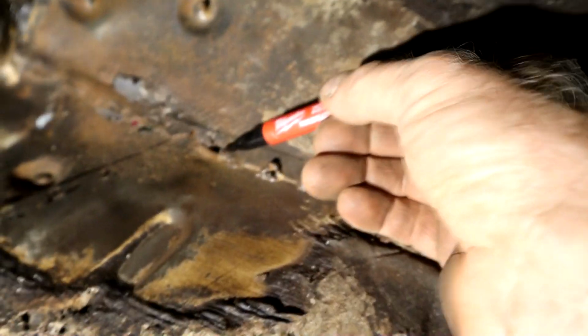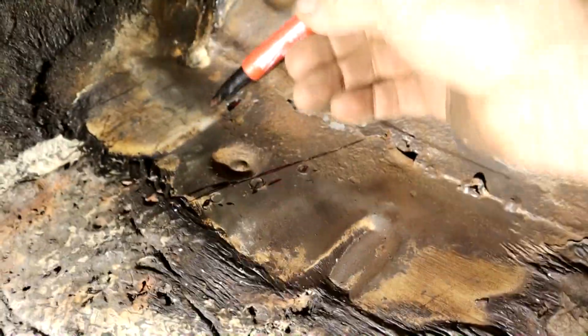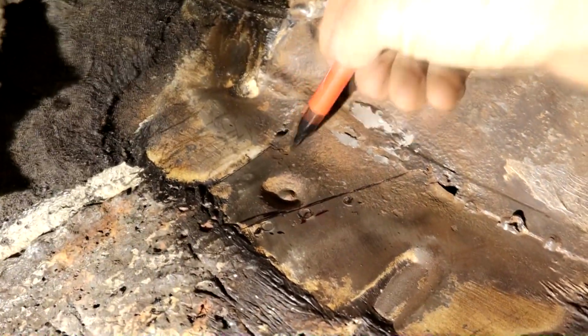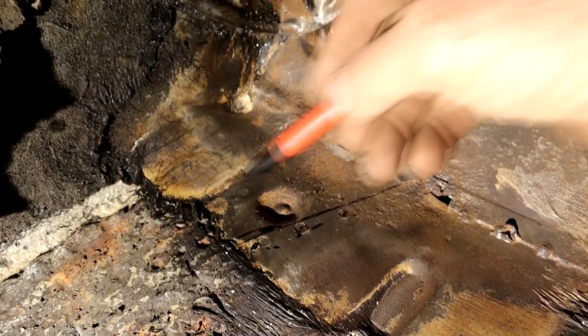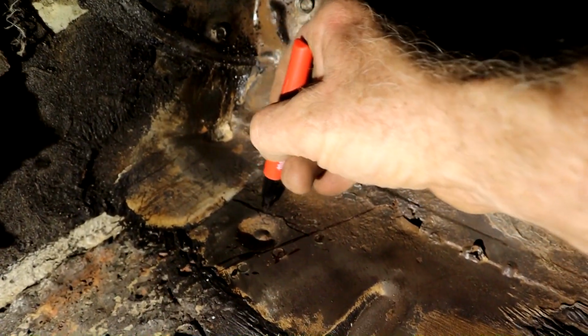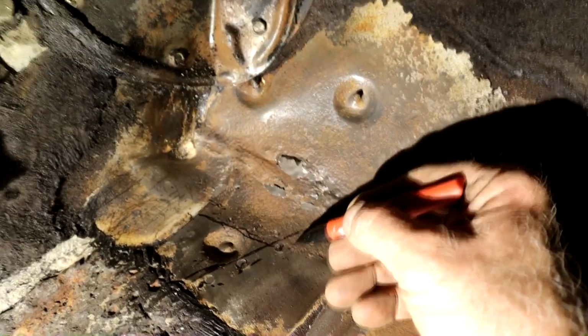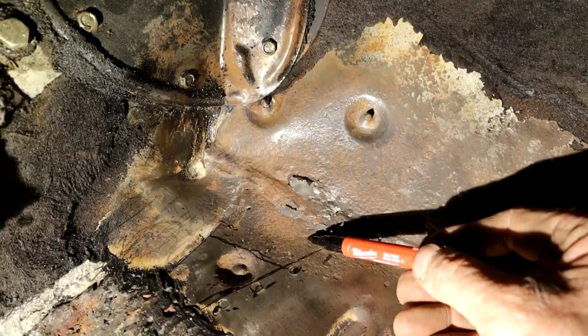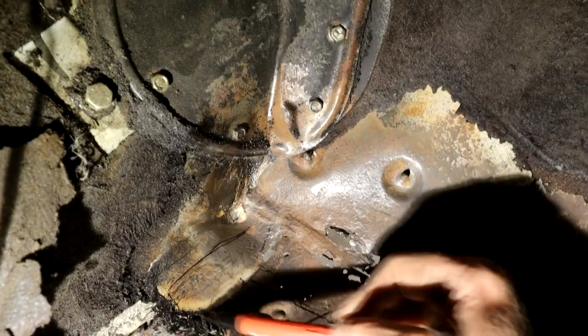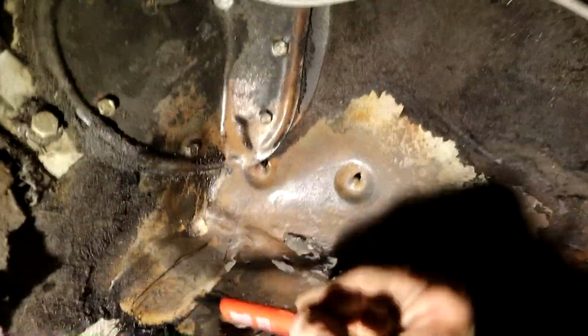And then we've got a little bit of business going on here. So see, there's the lap joint to the curved piece there, right? So I would like to take, these are those funny little holes that we found. This is good here, so I'm thinking if we took it across there just in front of that dimpled piece, right, take that bit out, and then we can drill these spot welds out, not these ones but these ones. Okay, so we'll release this piece out, and then this piece is pretty easy. We can just hack this one out, right, get that out of the way, and then the final one probably go up to somewhere like that. We'll figure that one out. I think that's the last one to go in, because that laps onto these.